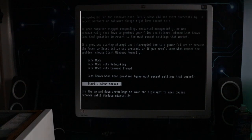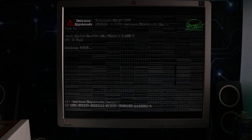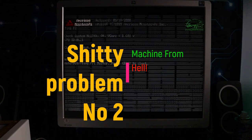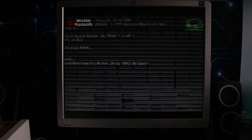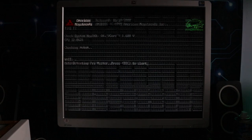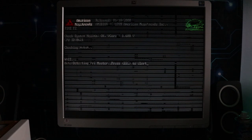And just when I thought I'd solved that problem, I started getting this. Suddenly graphics corruption on this GeForce 2 MX400, which is a real shame. Because it had been running okay for a while, and there was a lot of overheating evidence in that case originally on the processor and such, I wondered if perhaps it was overheating. So I might have a look at putting some new thermal paste on there shortly.